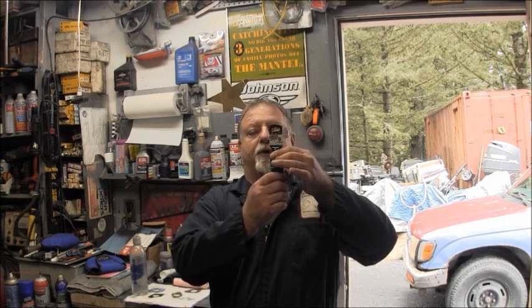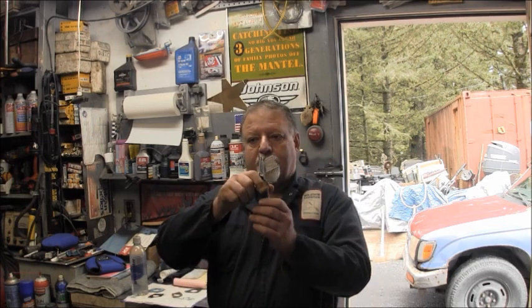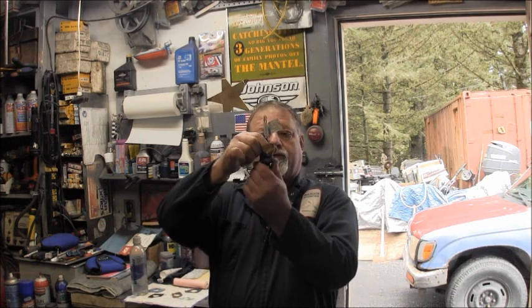I've done that before. What this ratcheting adapter will do: I've got like a 1940s, 50s big 1/2 inch Milwaukee drill that I use to spin over smaller motors, 15 horsepower or so and smaller. I also use it on the bigger motors with the spark plugs out for spark tests and that kind of thing. Sometimes them old flywheels can do goofy things, kick back on you. I can put this on my extension in my drill, and when the engine starts, it'll just keep spinning. So I'm a lot less likely to throw it in my outboard tank and electrocute myself.